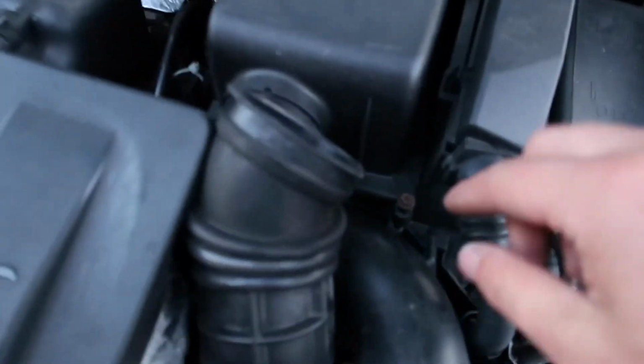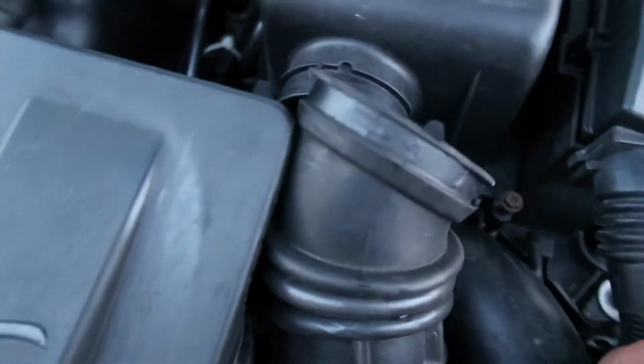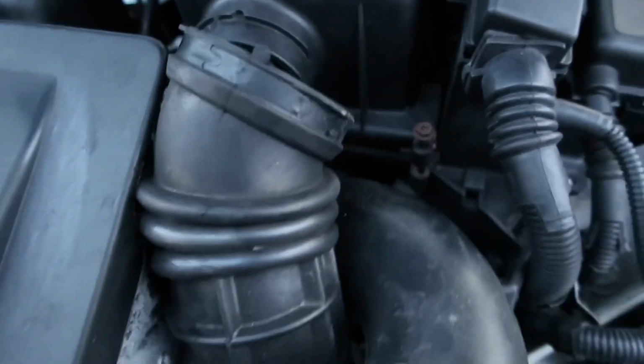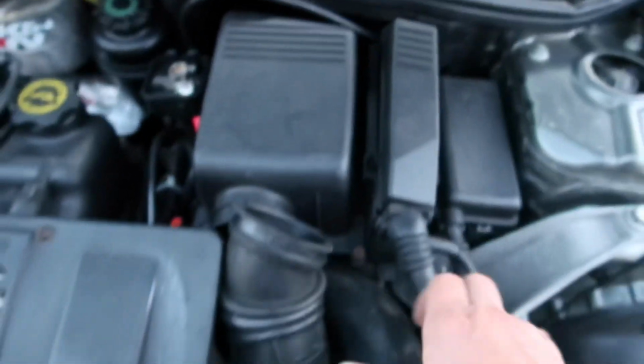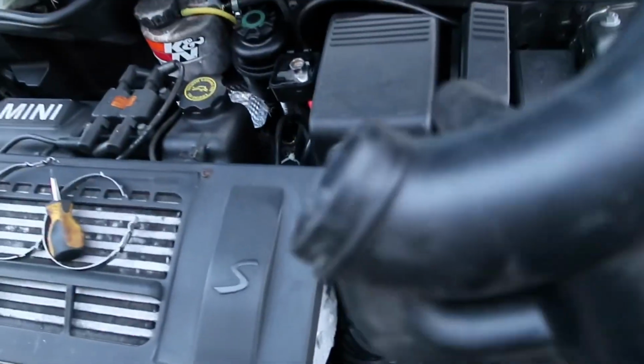Okay, so as being a Honda man, I think everything's a 10mm. These two bolts are actually 8mm, so they're both loosened off. This here now can pop out. We can bring it out past the, that's the airbox resonator out.